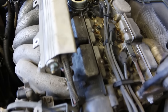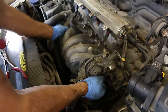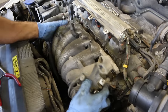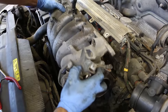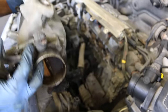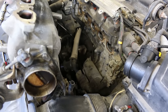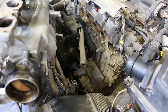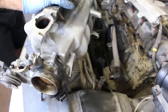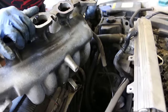You also have to move the fuel rail and take off the ignition covers. For removing the intake — we went a little fast here — there are bolts on the top and bottom. The top bolts come right out; the bottom ones just back off about three turns and then you should be able to take the intake out because it's kind of just slotted. Don't forget this hose, especially if you plan on keeping it.